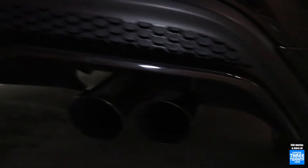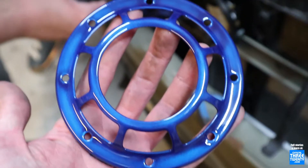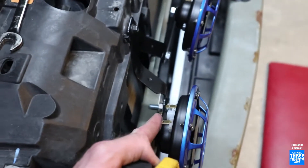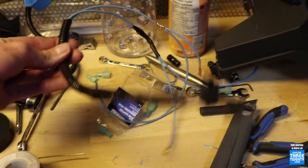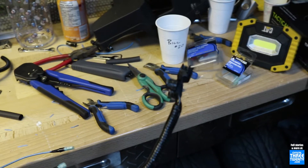I'm just soldering some stuff up front and you guys are going to be sticking the fins on out back in the meantime. Is it peel and stick mostly? Pretty much, yeah — and they hook on the inside with the little hook there, brackets to keep them from torquing. Horns are in, painted covers are on, and now we just need to make a harness to not only adapt the factory connectors to the spades on these but also lengthen it because it won't fit otherwise. That is my current task in this mess of a workbench. There's no tidy wire harness but that should do the job — it's all sealed up from the weather.